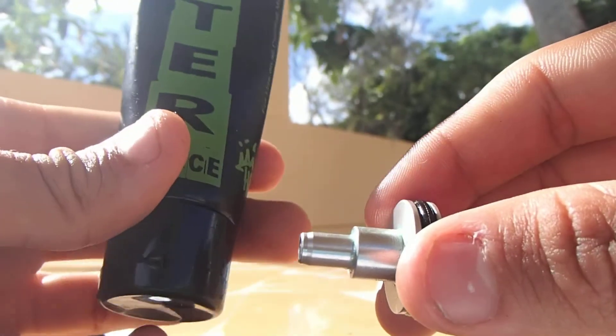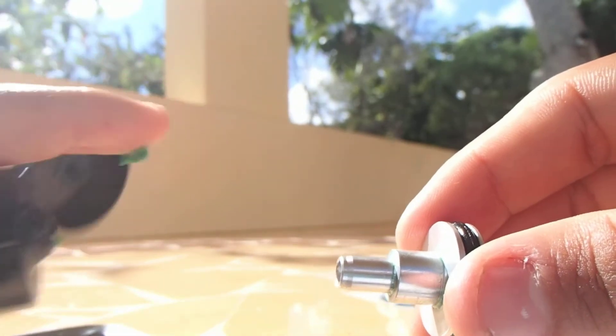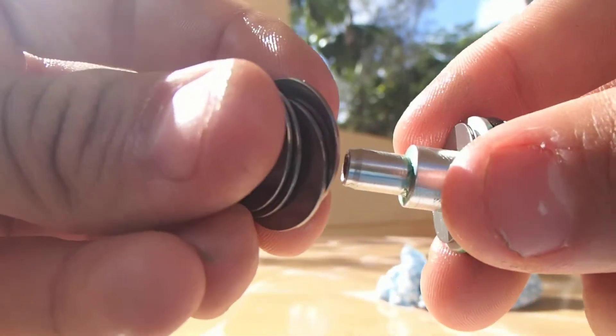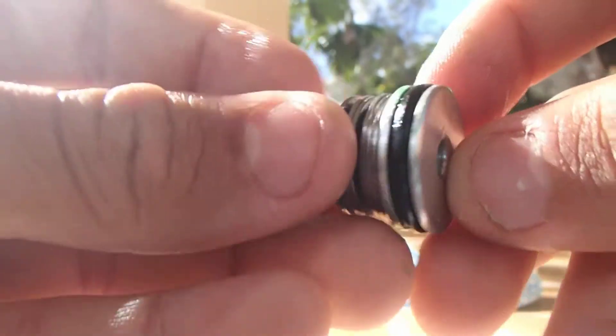You are going to use your favorite lube — I use Hader's. You are going to put some lube onto the piston itself. Just keep it nice and clean. Make sure that there are no particles — keep this as spotless as possible. We are just going to put our shim stack together again. Since I already have this, all I have to do is put them in. Just make sure that you put the stack in correctly so you won't have any problems.